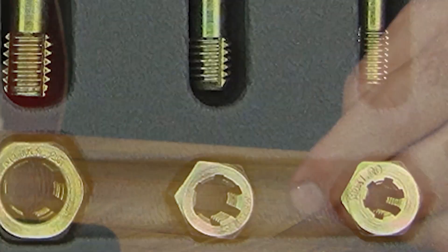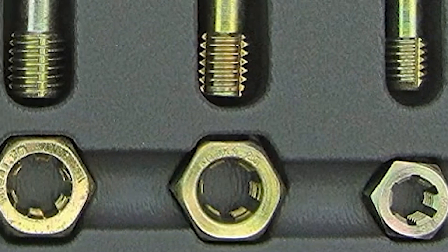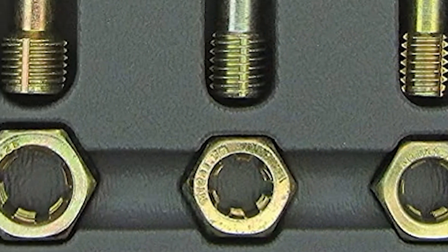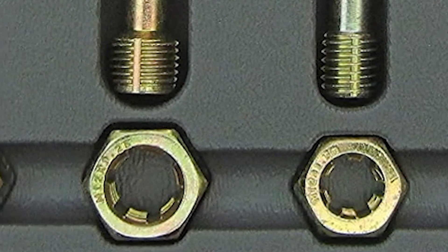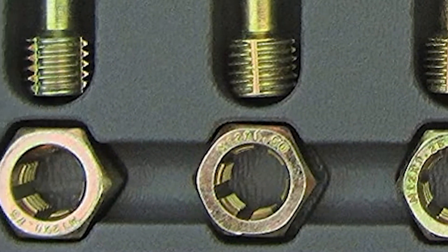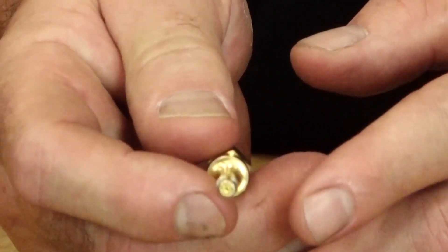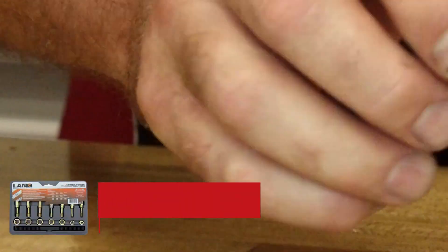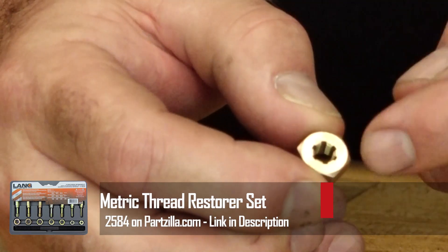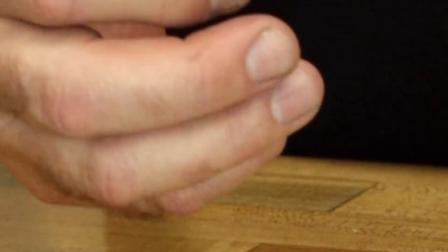Now with the restore, it is built basically the same way. However, your area for the cutaway or the debris are much smaller. And by making that smaller, you have a larger area where you're actually cleaning out the threads. With this design, you're much less likely to damage the threads. Same thing on the die piece as well — much larger surface area for the threads, less cutting area for debris.